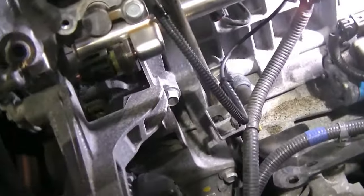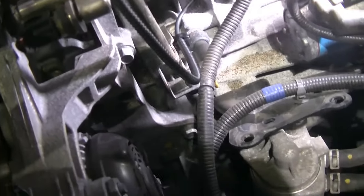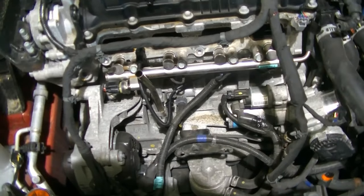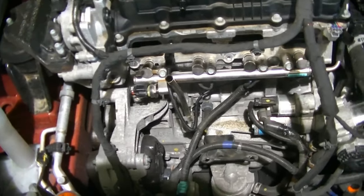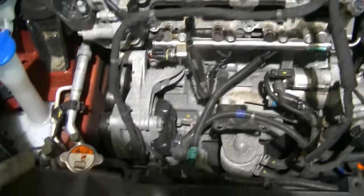Let's go ahead and slap our intake manifold back on. The first thing you're going to want to do is start these two bolts before you tighten the ones on the head, otherwise you might not be able to get them to line back up. Quick note here — don't forget your fuel injector silencer. These direct injectors are very loud and you will know if you forget to put that in there.